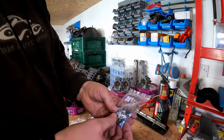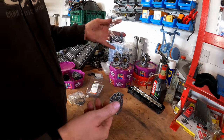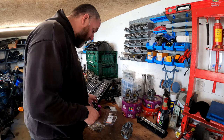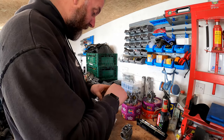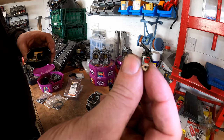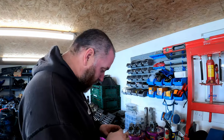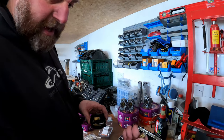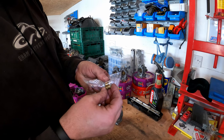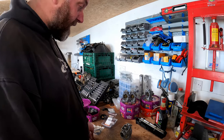I will be using the needle valve seats from the kit because the ones that came out were pretty horrible and the seals weren't any good. There's all sorts of hardware to replace most of the damaged ones that came out — screws for the needle valve seat, springs, top cap screws, everything we need to put it back together. The jets we're going to fit are the original ones, and as you can see they're nice and clear. I can see through them — there's absolutely nothing in there. Enough chit-chat, let's get stuck into it.